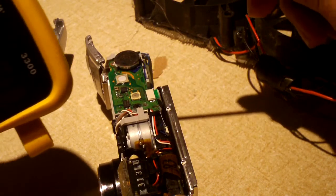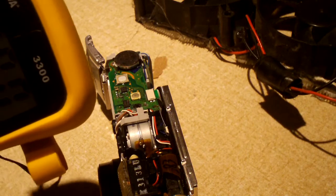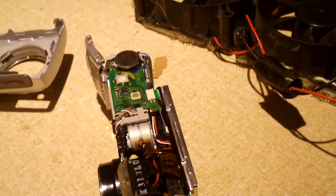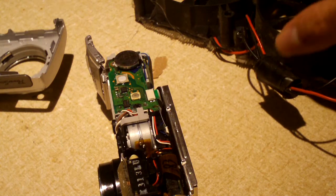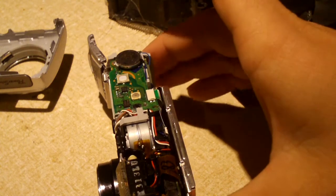So they always suggest that you use an alternative means. The multimeter concept was found out online, although I didn't actually have an analog multimeter like they suggested. I mean, this one here did the job just fine. I just sat there and monitored it till it got down to about 0. Well, once I got down to about 12, I connected these computer fans up to it, and just like that, it was discharged. So it's safe to say our camera is now ready to be worked on.